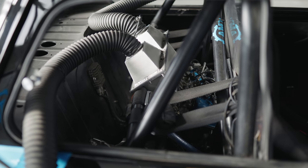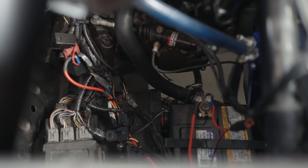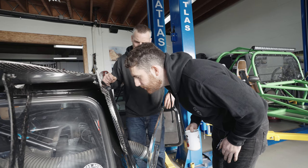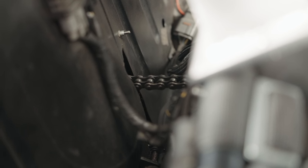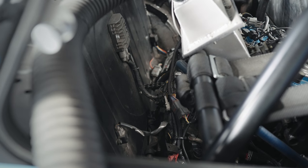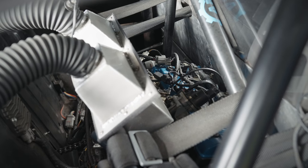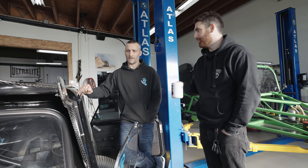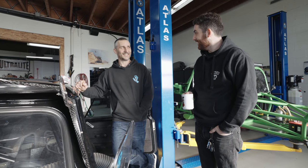The battery is mid-mounted right there, which is great for weight distribution. Looking inside, the rear seat floor is barely modified — there's only a small pass-through cut for the chain, and the floor of the seat area was cut out to allow dropping the engine out through the bottom. There's a Power Commander with auto-tune for managing the motor. The engine is a 2005 Kawasaki ZX-10R Ninja with 33,000 kilometers on it — and it's actually 998cc, the same displacement as the original Mini engine.